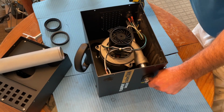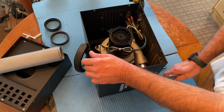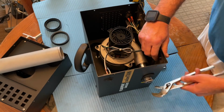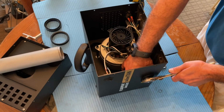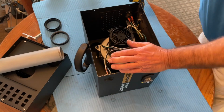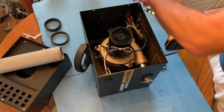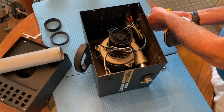There's a lot of residue on that. This turbine housing had a lot of overspray on it, and it looks like it's gotten into the thread. So it's more than likely this was kept too close to the sprayer. That's going to be difficult. You can see just by reaching inside there, I got black powder all over me. So a lot of overspray actually got into the unit, and some of that is probably dust from the brushes. The brushes got burned out on the motor.